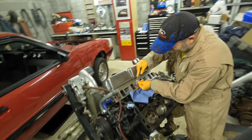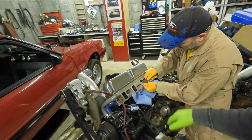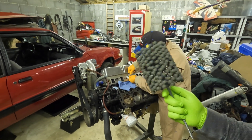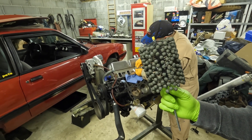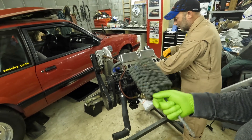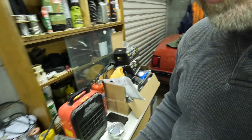We've got gaskets, we've got pistons, we're going to get in there. We gotta finish the bore up — just give it a little kiss with the flex hone. If you've ever used one of these they can make a mess. This is a super fine 400-grit one, so we're just going to run it up and out a couple of times to break the glaze and it'll be ready for the piston. So here's Pete.